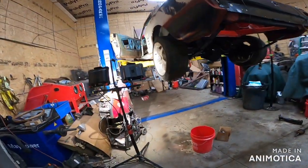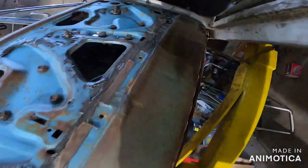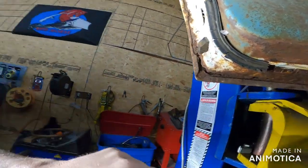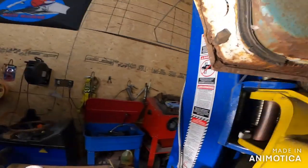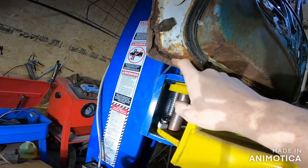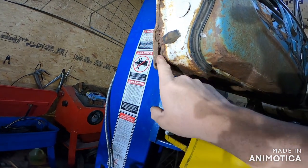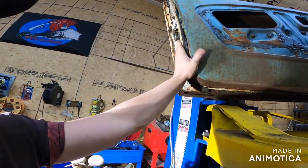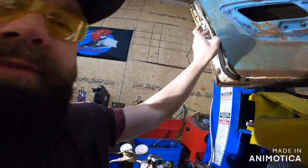We're going to do the same thing to that little hole up there in the door panel. I'll show you — we're going to do the tape trick. I'm not real happy about that because I have an idea and it's not great. Did somebody say seam seal? Yeah, I actually think that's what we're going to do with that — we're going to rust treat it first and let that set up, and then we're actually going to smear some seam sealer in there and call it good. Again, not a show car guys — this is just using these doors; they got one last hurrah in them.